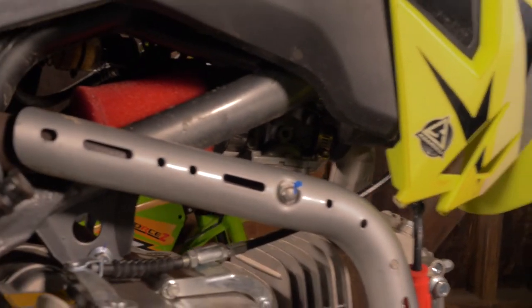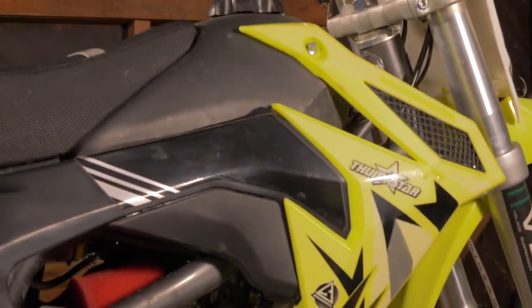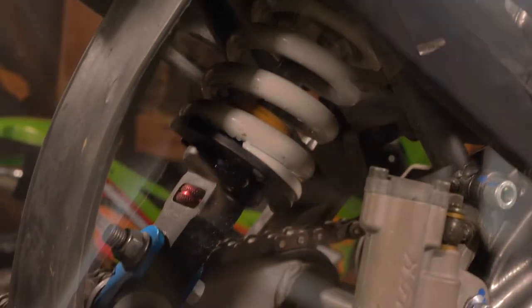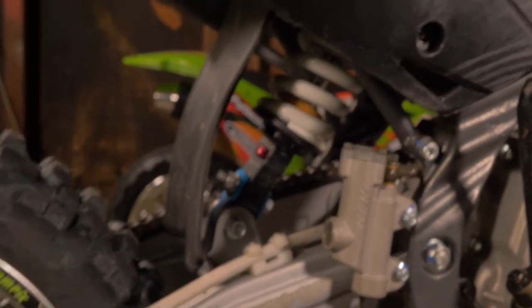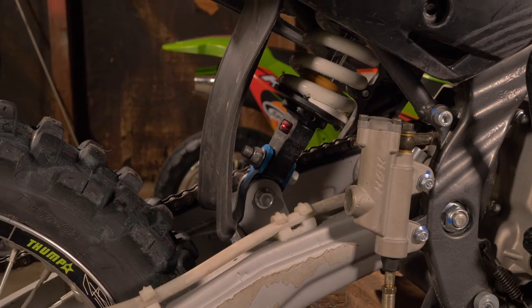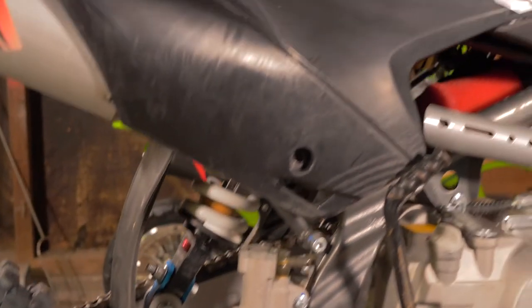I apologize for the camera — I'm using a GH5, it's not the best thing to focus on. Shortly after that, my rear shock went out. I just replaced it with the D&M rear shock — it's the piggyback shock. I love it. I average about 220 pounds, and I don't even have it to its stiffest setting, and I'm still not bottoming out. I had to put the shock extender on it because it was really, really short and it sagged a whole bunch in the back.